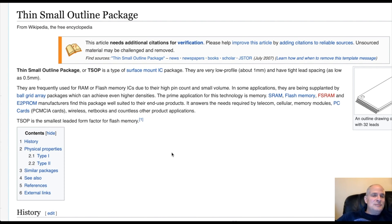However, on the original Xbox motherboard, the circuits that allow that chip to be erased and rewritten are disabled at the factory. So to be able to reprogram your TSOP, you just have to re-enable the circuits that make that possible.